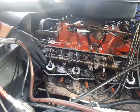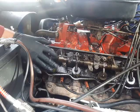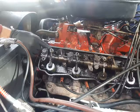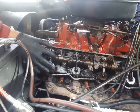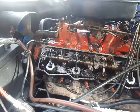All the process for the other valves are the same, and the main trick on all is, because these are not unscrewable, is to release this adjustment screw that goes to the push rod, to have then the possibility to slip the rocker to the side and have access to the spring.